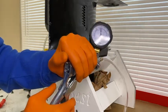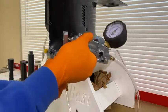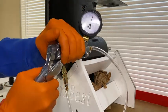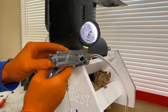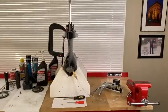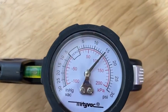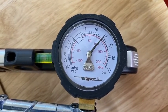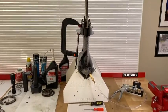We're just shy of 5 PSI, and this takes a few minutes and some friendly strength. Now we're just shy of 8 or 9 PSI. And DIYers, we are dead on 15 PSI, as you can see here. Great news — no hissing or any signs of air bleeding out from the rebuilt case. We are holding 15 PSI. We're going to give it about three to four hours. If any air seeps out, we need to address whatever is causing that. However, if we come back and it is deadlocked on 15, we are very happy — that is a successfully rebuilt lower unit.